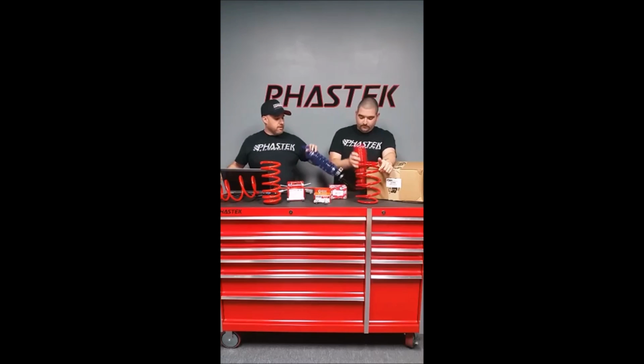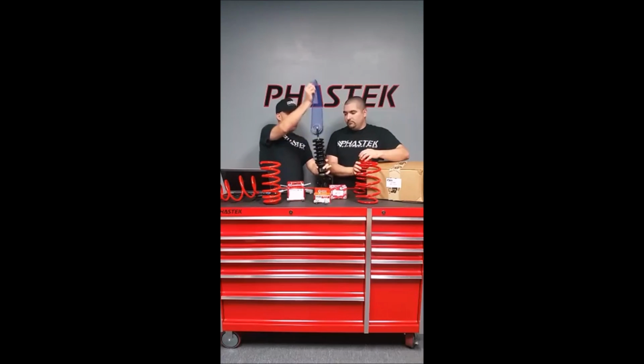Right. So you really don't require that on the 6th gen Camaros. Believe it or not, we have a 1.5 drop on our Camaro. The ride's nice. It's great. It's not factory, but it's not killing you. It's not beating you. It's not bouncing the car around. Because, I'll kind of show you on this tool over here, it's the shock travel. So basically, it's the point from here to here that you have. Obviously, as you're lowering it, you're bringing this together, and you don't have as much shock travel.